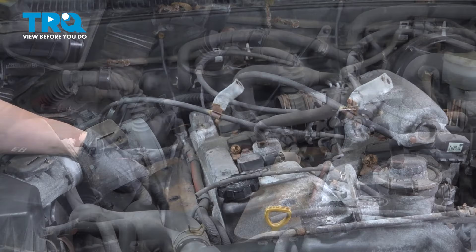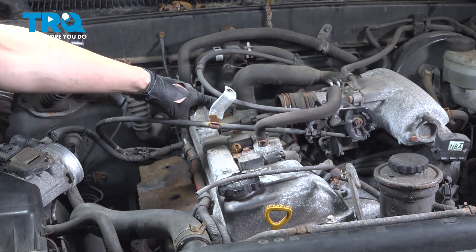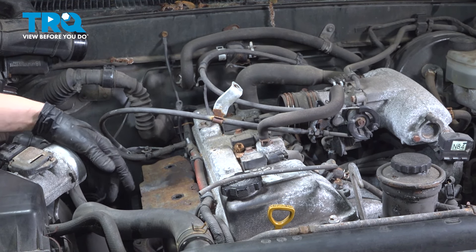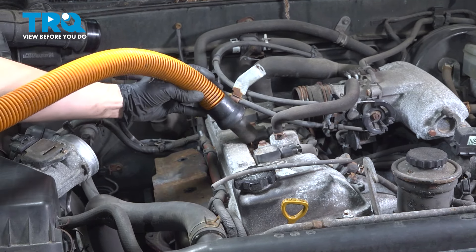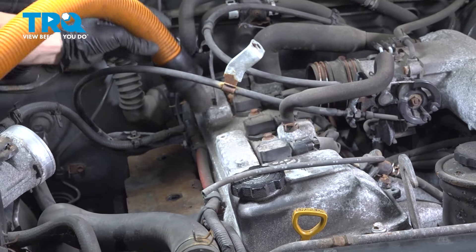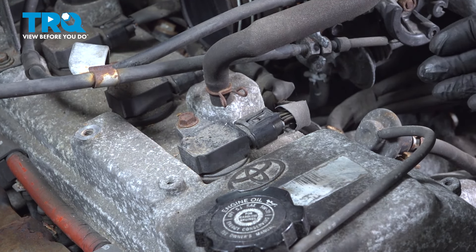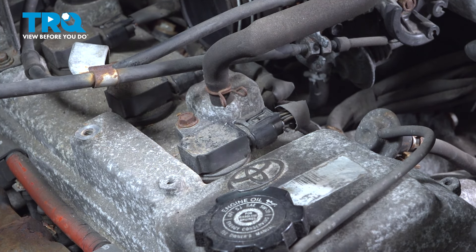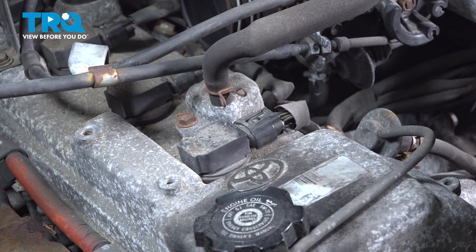And there's that. If you have a lot of debris here, vacuum it or blow it with some compressed air — just make sure it doesn't go down the intake. The throttle body is closed, but just make sure. I'm just going to vacuum it. Now I'm only going to show you how to do this on cylinder number one because the process at this point is exactly the same for all the other ones. You should replace these items in sets, so do all four at once.